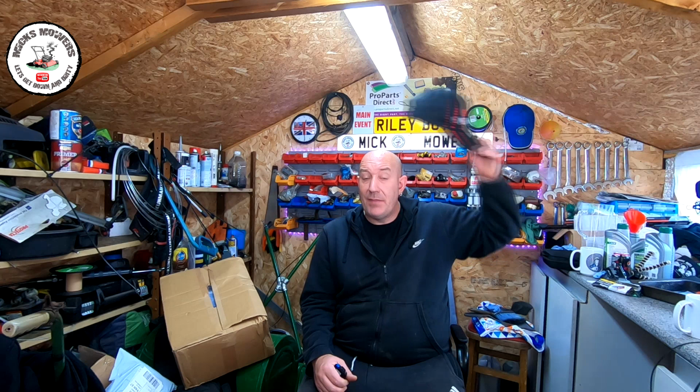And in today's episode we're going to be looking at the Dennis one more time. So far you've seen me do a points clean, carburetor clean, and I managed to get fuel all the way down towards the throat of the chamber of the carburetor. But on further inspection I'm not getting any fuel up into the spark plug itself when you crank it.